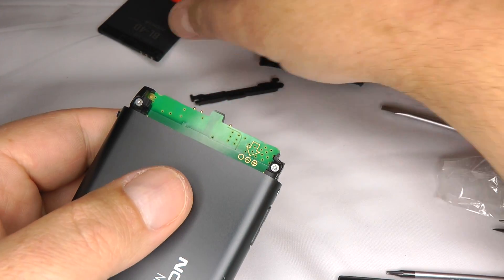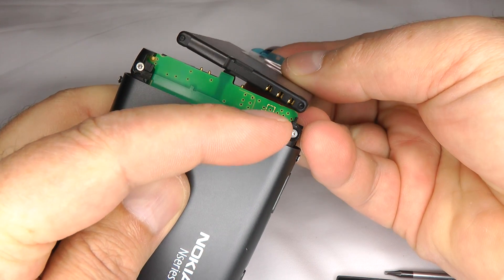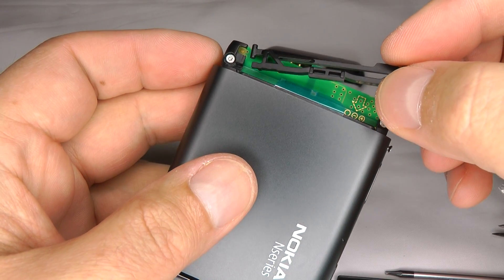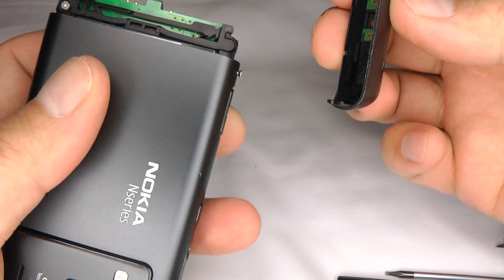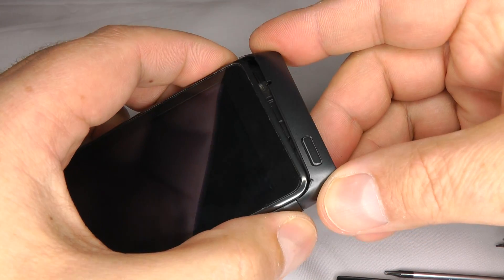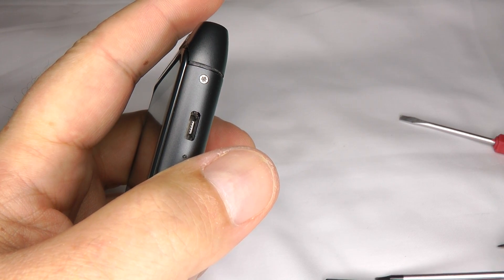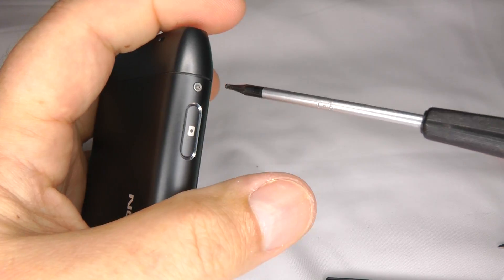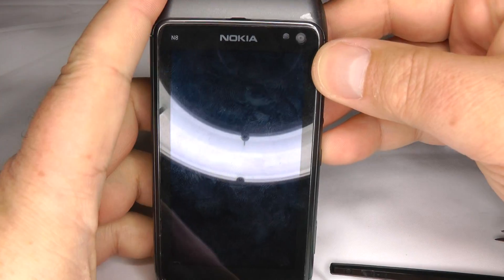Come to the bottom and put the battery back in with the gold connectors on the correct side. Then put the battery bar in by placing the T-piece into the little hole and back into place. Take the bottom cover and offer it up — it should just go into place. You may have a bit of a gap at the moment, but take your T5 screwdriver, hold the bottom down, and do up the screw. And that's it — it's all back together.